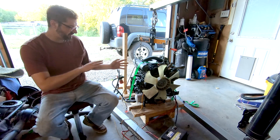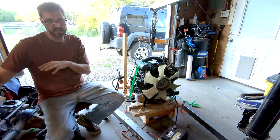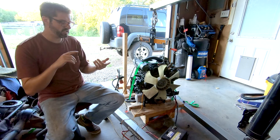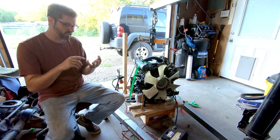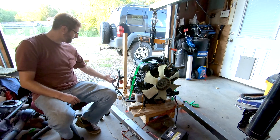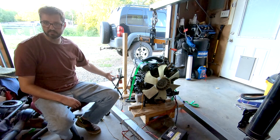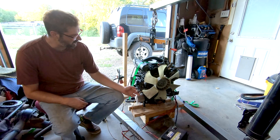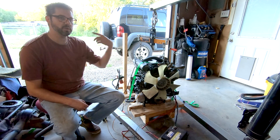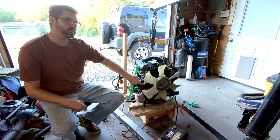Here's a quick setup of what's going on. This is an interesting motor compared to the V-2403 — I'll put a link in the description for when I got that one fired. The only thing I had to do on that one was supply fuel because it had a mechanical lift pump and a mechanical fuel shutoff. This one has neither, so I ended up getting this Duralift lift pump, which I'll be using in my 1947 CJ2A. I also had to wire up this cutoff solenoid — you have to energize it so the engine will actually start, and you turn the engine off by removing the 12 volts from it.